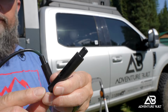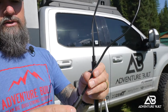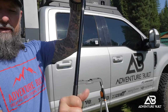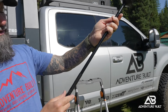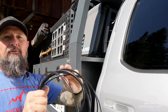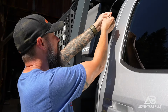This is the bottom part of the cable mast. You can see there's a big cutout. This is where the cable is actually gonna exit from. Insert it in, make sure the cable comes out, push it all the way down to the base, and then screw it on. Make sure everything's nice and snug. You might want to use a little blue Loctite on this just to make sure it doesn't come undone. Then this end screws into the wobble base up there. You've got your long extension cable here for the mast. All we're gonna do is uncap the protective cover and screw it on.